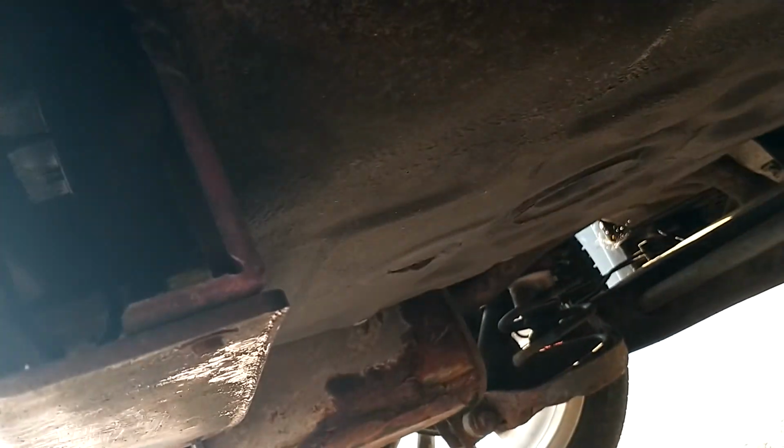From that you'd want to have a look underneath the car. And there's a slim support panel that runs along the back of the bumper on most cars. So if you can see that panel, this one, you can see any bends in that or kinks. It suggests it's had quite a hard hit. If there's not, and your boot floor is going quite straight, so it's probably just had a parking scuff.